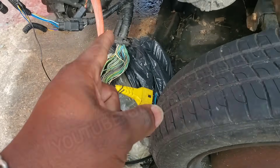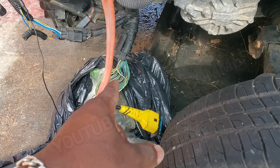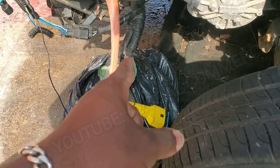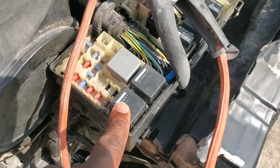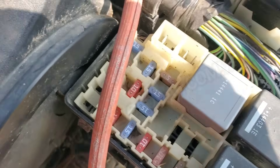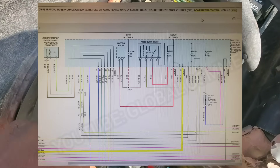So the fault now is most likely going to lead to the low power reading we're seeing on that gray and yellow wire. I think that's the next step we need to troubleshoot. Pulling up the wiring diagrams — this is the engine computer PCM relay, and this is the fuse that powers the ECM. We're going to check that fuse.